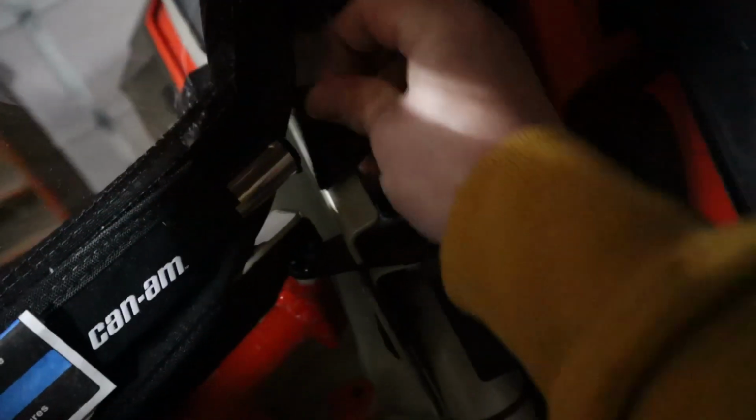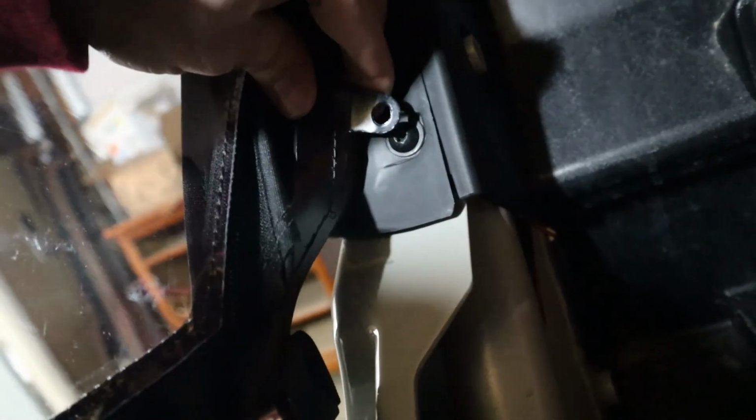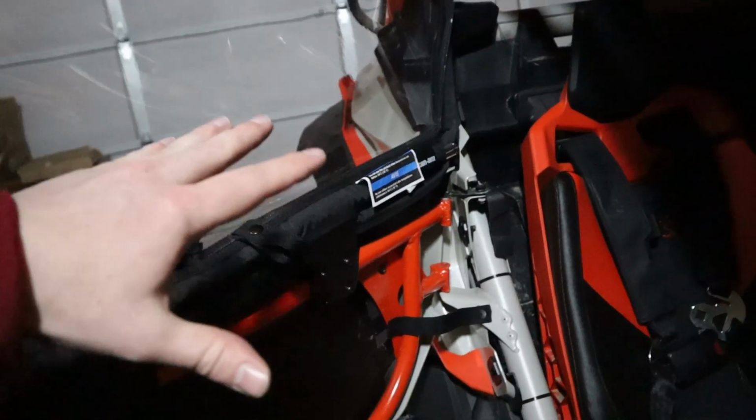This strap back here, it's gonna be kind of a pain to get to. This one, undo this, and it just wraps around this piece of plastic right here that kind of covers up this hinge. You can go ahead and throw that one on, and then there is one tab. I know it's gonna be kind of hard to see. There's one tab. You gotta take this T30 Torx out, and then the tab kind of just chills in there like that. Tighten it back down,